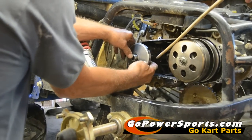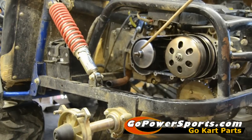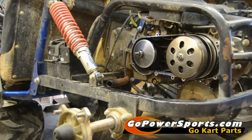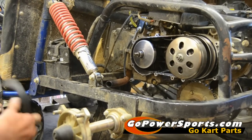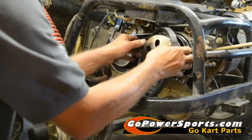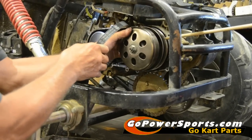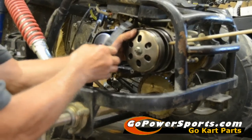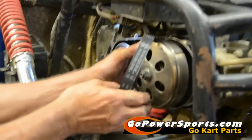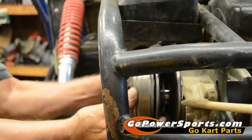You can see Scott's holding it with his fingers and he's pushing here, not on the pin. Now that he's all the way on, he's going to put his belt on. You're going to start it around the rear pulley and you've got to pull open this pulley. You'll pull this open and if you twist a little, it'll open easily for you — just like this.